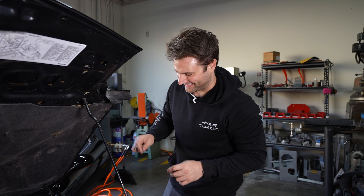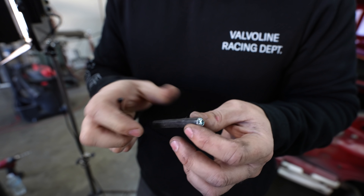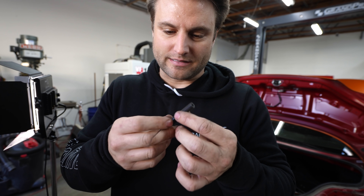I'm able to find a cap — a little nipple thing that you can get a little pack of at AutoZone or whatever — but since this isn't my car I wanted to make it fancy, so I used a little button-head bolt. That's actually cleaner than the nipples. We'll zip-tie this for extra safety, but I don't want anything I do to fail in this car — the rotary engine can do itself in. This is the first time I'm doing real work on somebody else's car. To cap off that last vacuum leak, there are no barbs on them but it at least gets us even closer to doing a base map. I forgot this was running the stock ECU — so I'm going to have to make a new map because none of my cars are even close to stock. It's a good exercise for me to start from fresh and make sure everything is done properly.